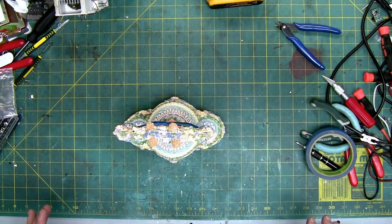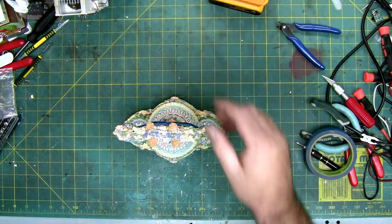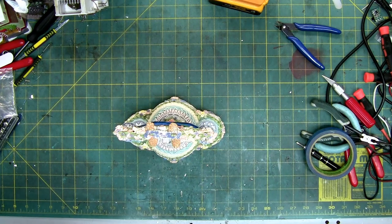If it rattles and you're like, oh my god, something's wrong, you probably lost the screws. You can use Loctite. You can even put hot glue on the threads. You just need something to increase the friction coefficient. You could wrap the threads in Teflon tape. You just need something to produce more friction. I like using glue because it's not as permanent as Loctite and not as temporary as other stuff. You can also use clear nail polish or colored nail polish if you want, and it'll do the same thing.